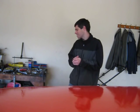The next thing I want to talk about is these old air-cooled Volkswagen cylinder heads in general. The old air-cooled heads on these Volkswagens have always kind of been known as being a sensitive, commonly replaced kind of part. When they wear out, they drop a valve and have an issue like I have here in this video. And when they're not adjusted right, they burn a valve. You're always kind of tending to the cylinder heads and making sure they're good. And that's kind of always how it's been with the air-cooled Volkswagens.